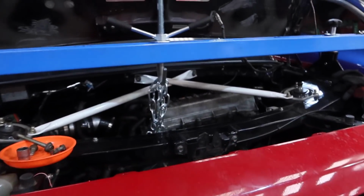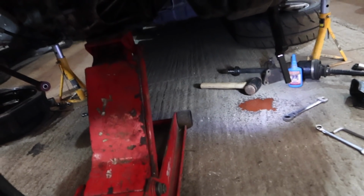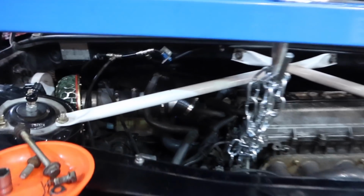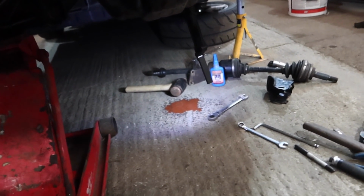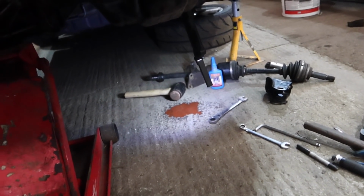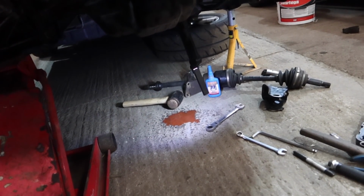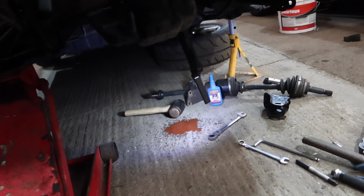Just a little mid putting everything back together update. It's done a little wee, and it's from the thermostat. Now I think because I had to jack the engine up slightly at a weird angle, because I'd forgot to put the shift things, where the shifter cables sit on, which was obviously a right pain in the ass to do, but we got it done. But I've put some awkward strain on the thermostat, and it's a plastic housing, and you know how I feel about plastic thermostat housings. Well, hopefully it's not cracked. So I'm going to wipe that up, and hopefully there's no more weeping. But it was straining it enough so that it could weep past the gasket. So that's not good. Right, it's definitely going to be a 3-part video now. All in the one video, of course.